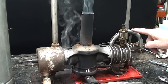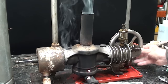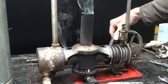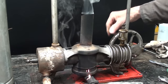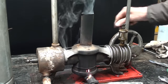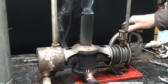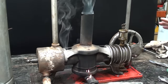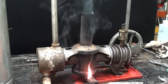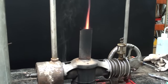You can always tell the direction of rotation of a Stirling by the way it's timed. If you attempt to turn it the wrong way, you'll see it's not going to work at all. But you see it's trying to run — either it's not hot enough or there are other issues, and I think there's a combination of issues. I did have it hot enough where it seemed like it ran a lot better than what I'm showing you now. But for illustration purposes, that's good enough so you know I need to work on it. I'm going to turn off the burner.